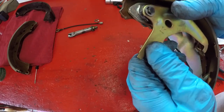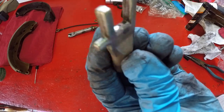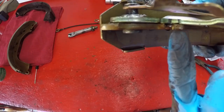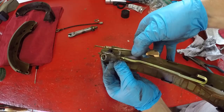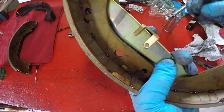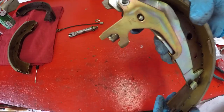Put the adjuster end piece in — you can still get this part of the adjuster in with the E-clip on. Lubricate the end of the adjuster as well, including the shiny sliding surfaces and a little grease on the pin for good measure. Slip the adjuster into place so the brake shoe and parking brake lever contact it, then capture the pin with the automatic adjusting lever. Install the spring onto the automatic adjusting lever: the short end goes into the lever, the long end goes into the brake shoe. Now this end is all reassembled.